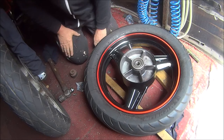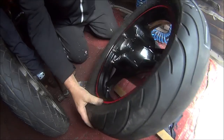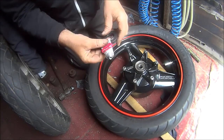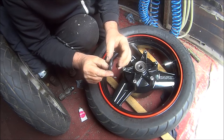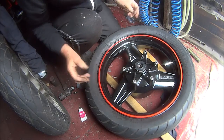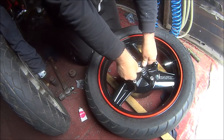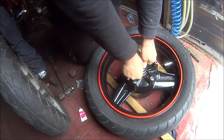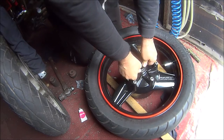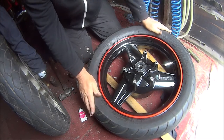You can tell we're there because of the sound change. Okay then, going back to the other side, get our new dust seal, put a bit of rubber grease on it, just a little bit, wind its way home. Just drop that in there, push it with your fingers. There we go — that should be perfectly fine. Okay so that's the wheel.